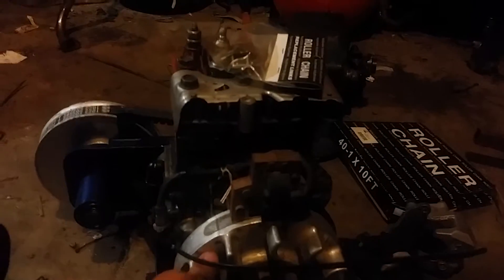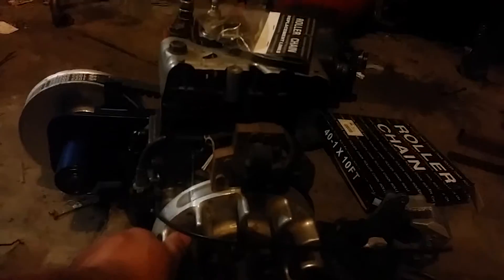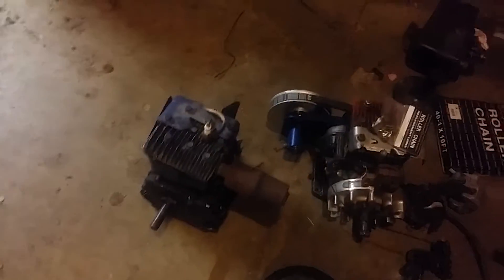I got some hubs down here that are five-bolt hubs, one-inch axle, etc. But the stuff I will talk about right now is this is a performance engine, maybe a Briggs & Stratton. It has an advanceable flywheel on it. It has an ARC connecting rod and piston, and one of those paper-thin copper head gaskets in it. I don't think there's much else important about this engine other than that stuff. It's not built-built — it's not like bored over or anything that I know of. But that's gonna be what drives this thing with the torque converter.